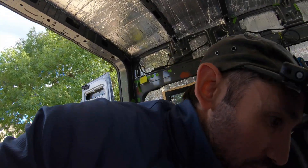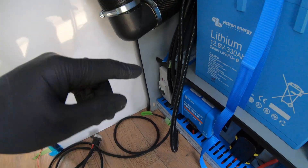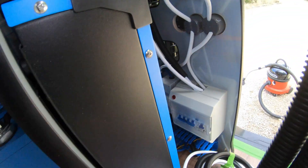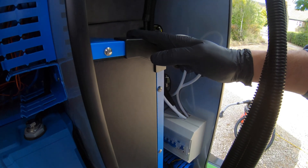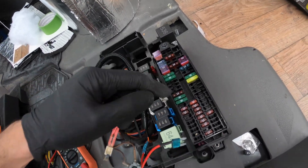Next job is to flick the power on from the battery. I'm guessing I'll have the engine going so that we're getting current from the alternator — make sure all the isolators are off. The solar's off because that's not plumbed in yet. Those isolators are off. Annoying — I have put in the wrong size blade fuse. I've put in a mini one because I thought it went there, but the ignition live actually goes here. So I've just ordered some from Halfords. Whenever you think you're nearly there, you're not.